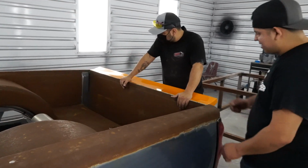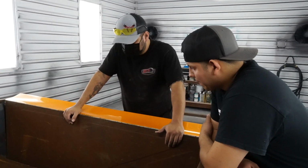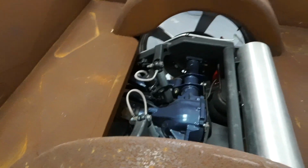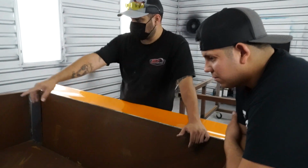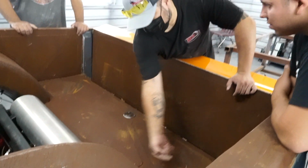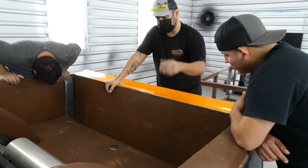What we're gonna have to do is re-weld some parts because the gap is too big. Yeah, right here. We just add a little more and re-bevel it, and then put the seam seal on, so it doesn't crack. Because if there's too big of a gap like that, it bleeds through, and you'll have to do it underneath too, so when you look from below, it looks smooth as well.